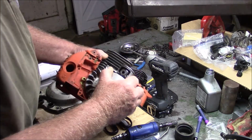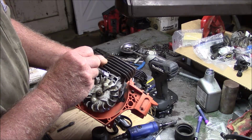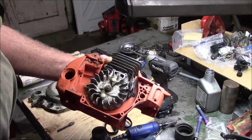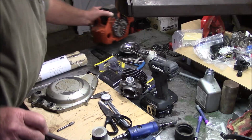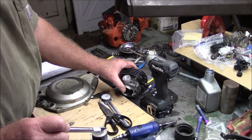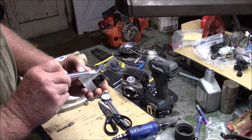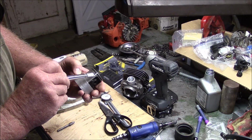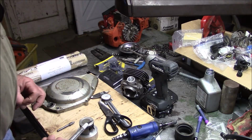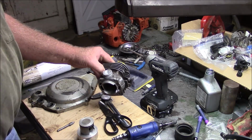And if you do a pop-up, see how you machine the crown just a little bit, that what I call interference is going to be less by whatever the pop-up is. So this one here is an old research build I had done on a 350, and I was trying to jack compression to like 200 pounds. On this cylinder, we're only dropping it, say 20 thousandths, because it's going to have a no base gasket build. And the pop-up is down approximately that same 20 thousandths. So the edge of this piston is going to be literally right at the floor of the transfer, at least it should be pretty close. So that whole idea of having the piston interfere with the flow of the transfer as it enters the combustion chamber is going to be minimized. But I'm still going to get my compression increase because of the pop-up. Does that make any sense?